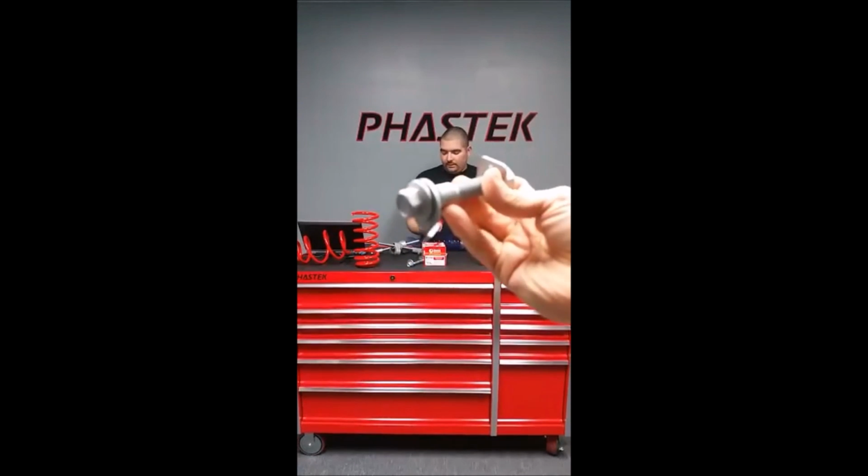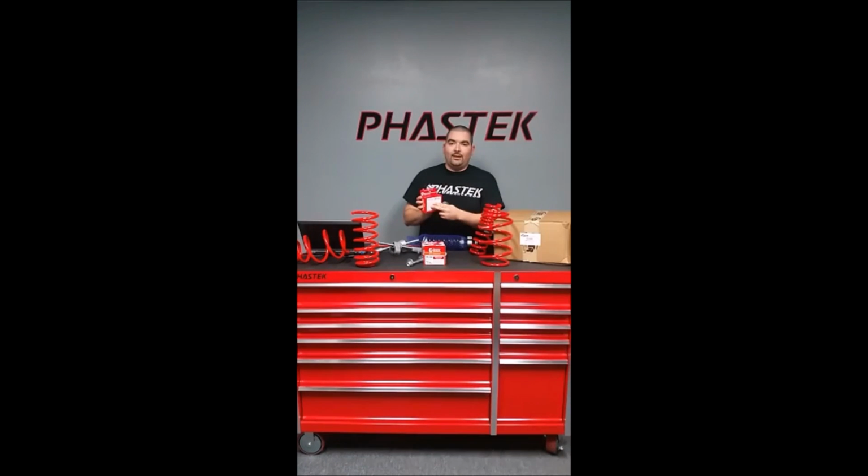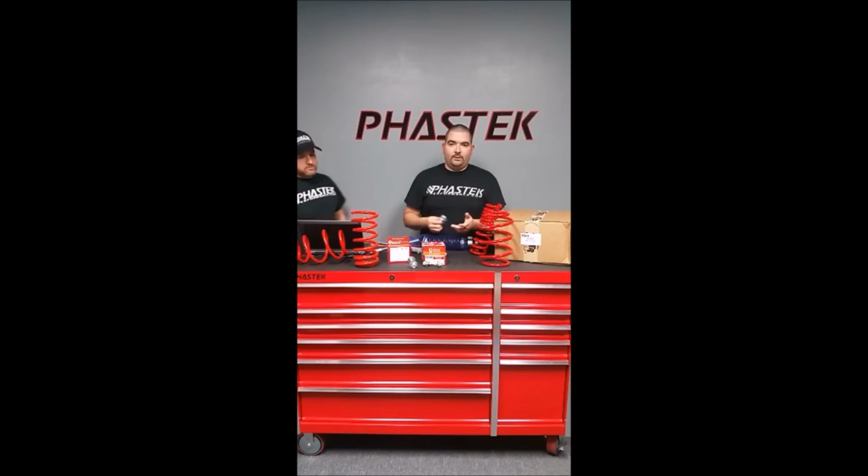Like we said, because the thing is, they adjust. The kit itself is a camber and a toe adjustment. So you have both new bolts. Then you go to the alignment shop to get them perfect when it's back. Or if you're racing on a certain spec, they can dial it in right then and there. So two kits for the rear, one kit for the front, and you're set completely as far as alignment bolts and everything, camber bolts that you'll need on a fifth gen.